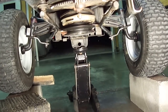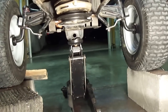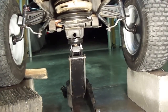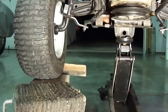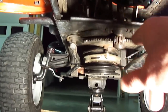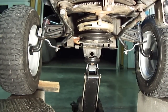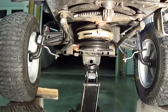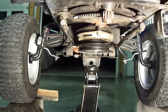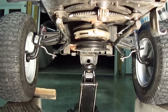I disagree with that. I will say set your parking brake. That aligns these two pulleys and puts a boatload of slack in the belt. I start my belt, do your loop through the front there up to the PTO, loop it around, and once you basically can slip it past the little rain guard that goes around your pulley in the front, I use an upholstery tool or a screwdriver, works fine, but it will slip by it and you don't have to disconnect any extra stuff.